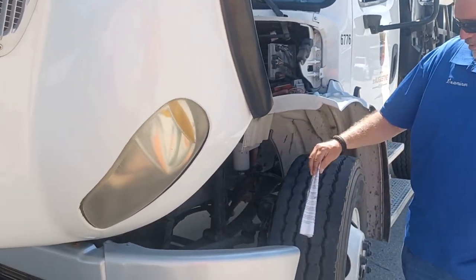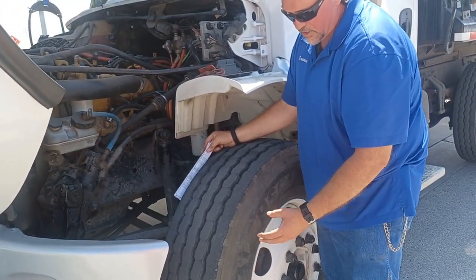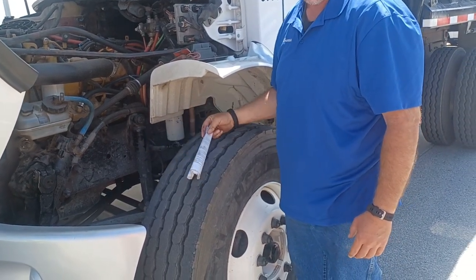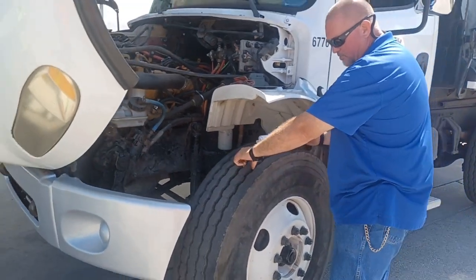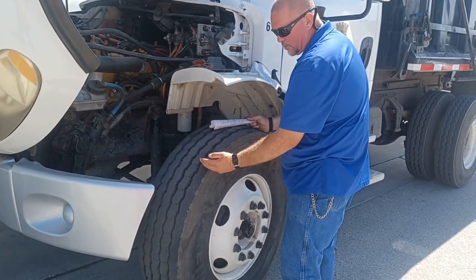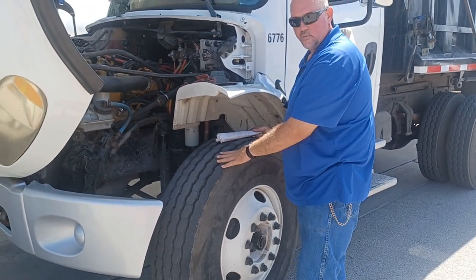On our way out, we're going to look at the tire — both sides. There are no dry rot, holes, bubbles, or cuts. We're going to look at the tread. The tread depth in the front should be no less than 4/32nds of an inch — this one is real big and meaty. It's not unevenly worn. There are no gouges on the side, no scalloping. There's no edge wear, so the alignment is likely really good.